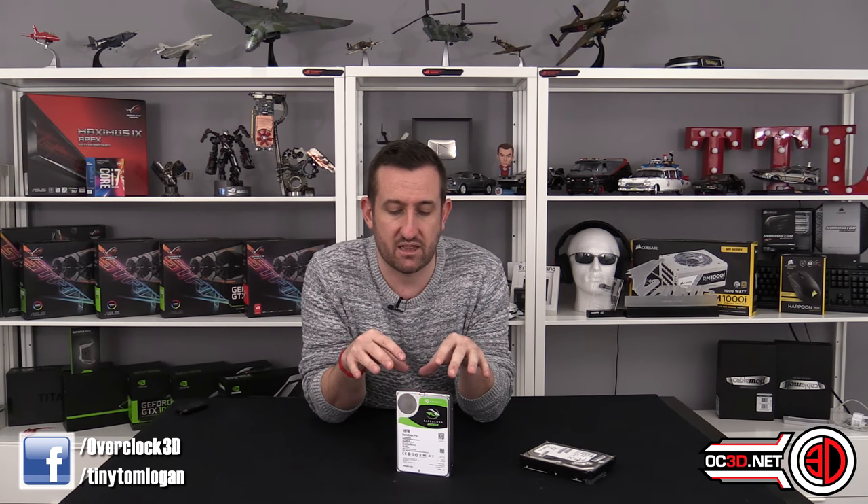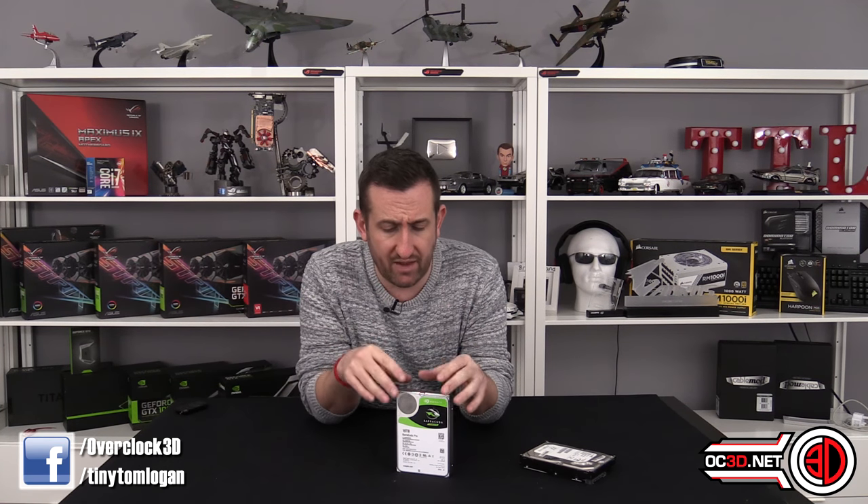If the cage you put it into before it goes into your case is even ever so slightly loose, then the vibrations will pick that up. So it might be worth exploring other avenues. There are some mounts you can get in the aftermarket where you can get rubber mounts to go in with them, and those will help you no end.